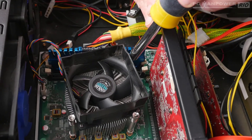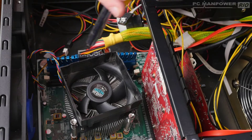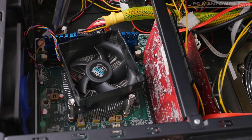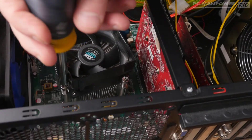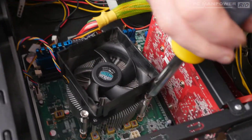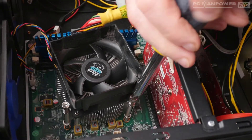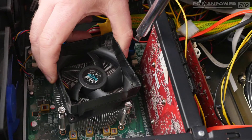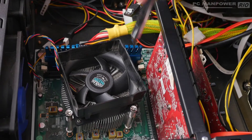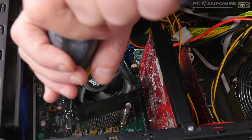I'm not going to undo each one fully. I'm just going to undo about halfway on each one at a time, so I can gently make sure that this is level all the way. I don't want to pull the CPU up on one corner and perhaps cause some damage. So I'm just turning one by one — still tight in, so just unscrewing a little bit more, keep going, and that one, and the final one.